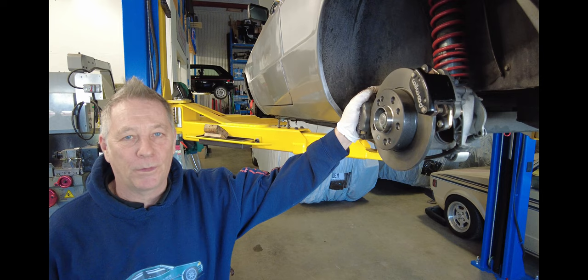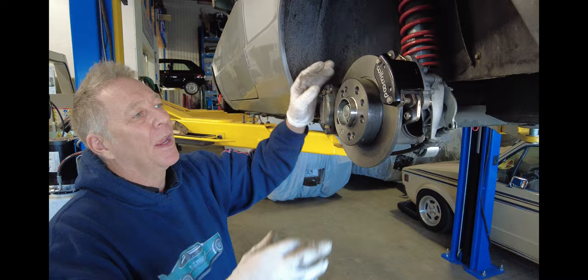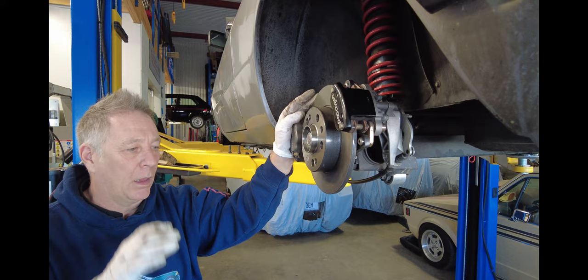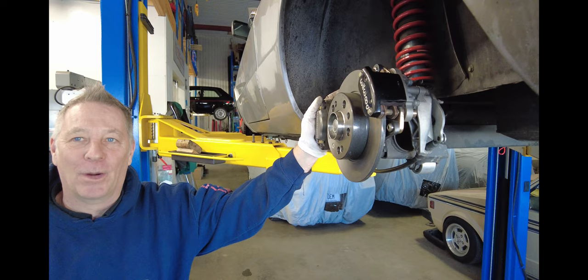On this side, you can see our rear big brake kit for MK1, 2 and 3, Corrado, B3 Passat and B4s. This kit is very well balanced to go with either our big brake kits in the front or OEMs. In the kit you will find button-head bolts in 3/8-24 fine thread for the Wilwood caliper, modified in-house to clear the outside of the disc. Everything is well packed in bags, organized and identified.